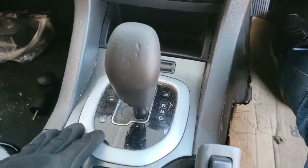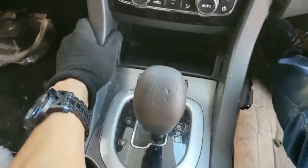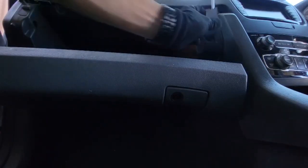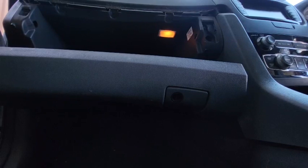Now start doing the gear stick area. Lift up this piece, then remove the side half and keep going. Use a flat screwdriver to pop this cover out here, and another one on the left side. Put them in a secure place, then keep going to unscrew.